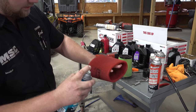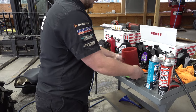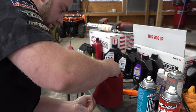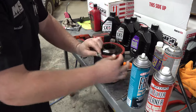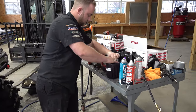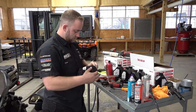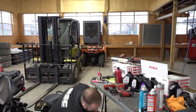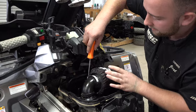Then you're going to do the same thing with the inner foam piece, slide it back over, and then the outer wear slides right over the top of all of it. Maximum engine protection — just make sure you get a good even coat of oil, especially on that outer foam. You'll have maximum engine protection. But you still want to clean this quite frequently, and the more dusty conditions you ride in, the more frequently you need to clean your air filter. Then put that back on.